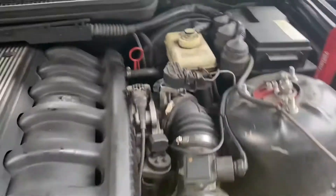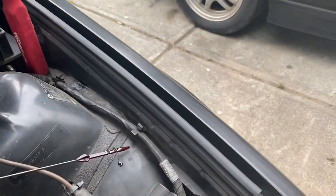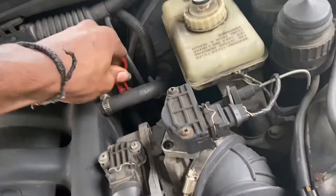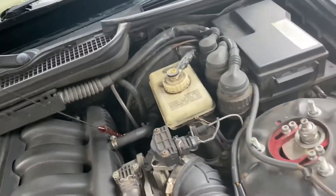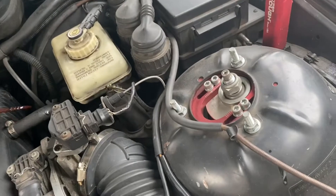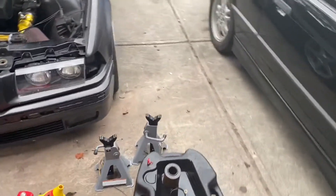And don't forget — when you're all done, take out the dipstick, give it a good wipe down, put it back in, pull it back out, and take a look at it. It should be over the second line, which it is — that means you're full and you're ready to drive. Thank you guys for watching Project Garage; we'll be back another time.